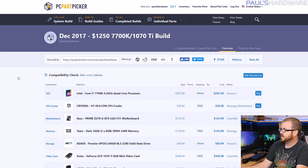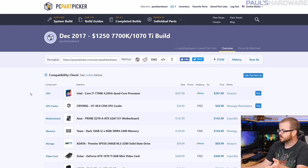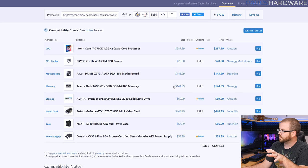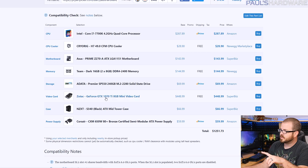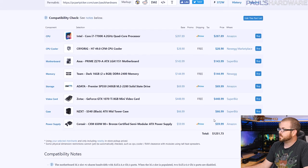I've got one more build — a gaming-focused Intel 7700k-based system. If you're doing video editing, 3D animation, or gaming and streaming simultaneously, I'd recommend the Ryzen 1600 build instead. But if you're purely gaming, the i7-7700k can be had at a pretty decent discount compared to before the Coffee Lake launch. Combine that with reasonably priced Z270 boards and you get a powerful gaming system with a quad-core, 8-thread CPU. The graphics card chosen is a GTX 1070 Ti, and the overall cost is around $1,250.